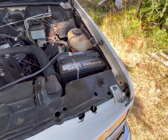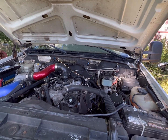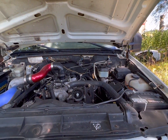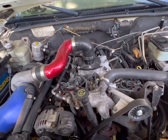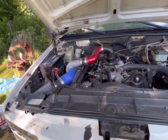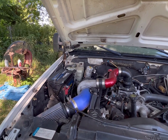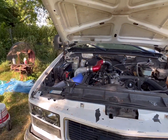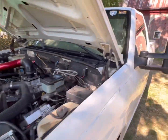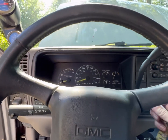I don't have one of the big fancy battery cable kits on this truck. I do have good, relatively new batteries in it, and I've never done the updated glow plug harness — it's factory from '99 and works as it's supposed to. The PT Wiring slash Zombie Solutions battery cable kit is worth its weight in gold, really, because Bruce did a good job of cutting everything and making it pre-length. This being my farm truck and former daily driver, I fixed it when I could. With everything grounded the way it is, you should have really no issues starting.